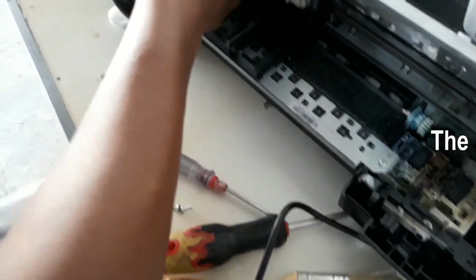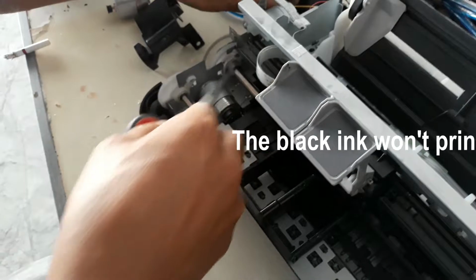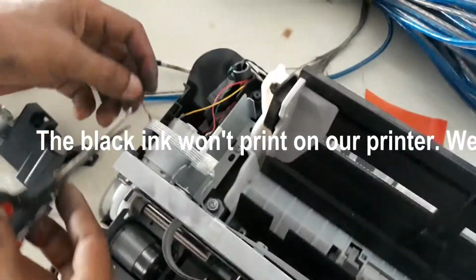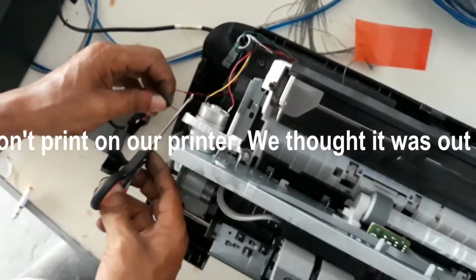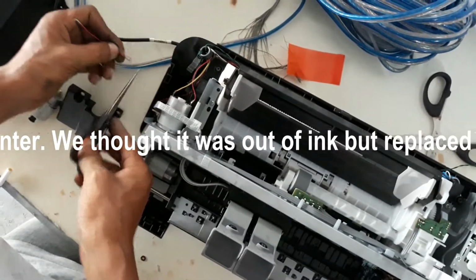Did you remove the little piece of tape on the bottom of the cartridge? I was having the same problem today. Ran the carriage under water and dried it. Still didn't work. Looked under the tools menu on the printer screen and noticed "clean cartridges." Chose that option. I guess it did the job, because it ran a test print and when we tried to print again it worked just fine.